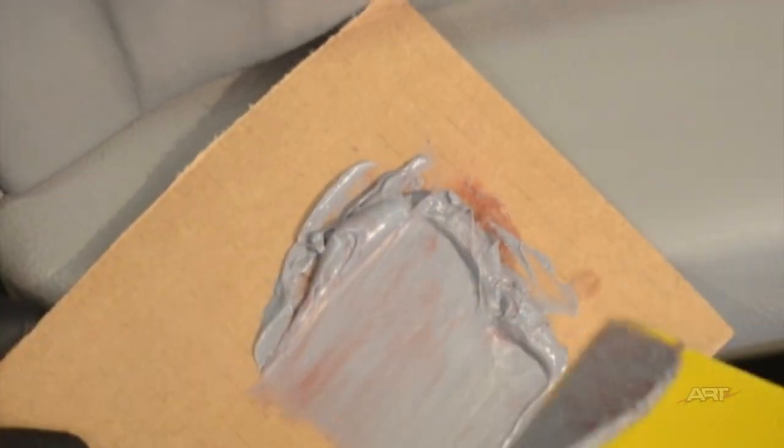You can see how the guide coat helps when determining the level as we're sanding. When we talked about the repair being the same weight as the vinyl, this is what we were looking for. Padded dash filler is a flexible polyester filler which will allow us to contour the repair, while even yet adding a bit more to the structural integrity.